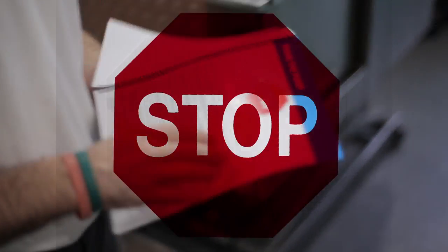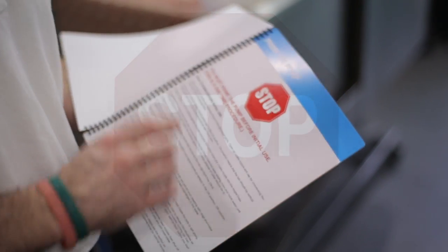Prime the pump. Stop. You must prime the pump before initial use. This is a one-time procedure. This is a very, very important step. In order to get the motor to suck in all the water, we have to prime it before initial use. Again, you will never need to do this again unless you are lending it to someone or for resale and you have to dump out all the water. So let's prime the pump.